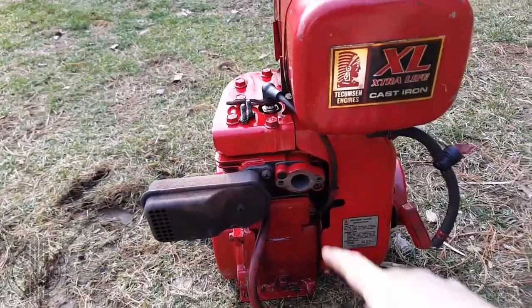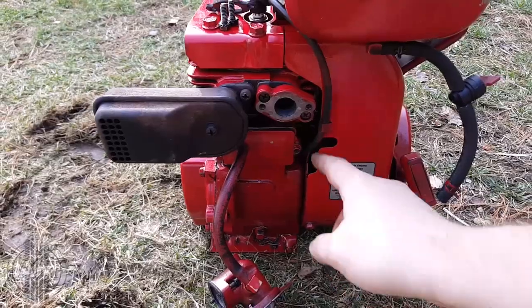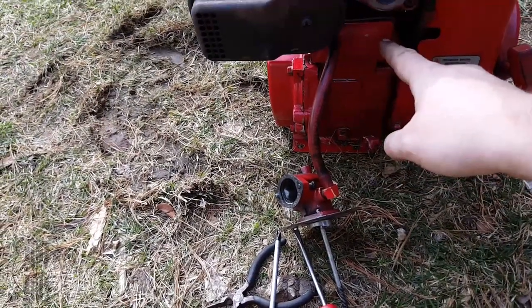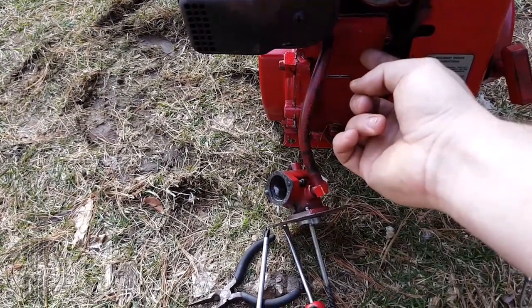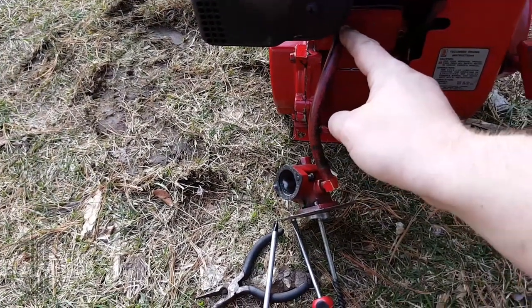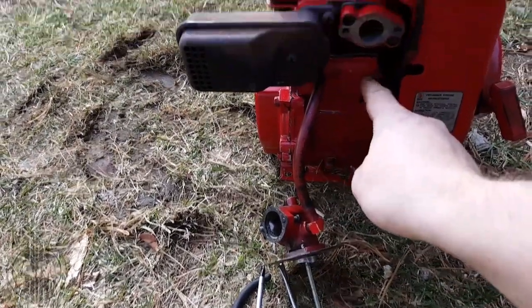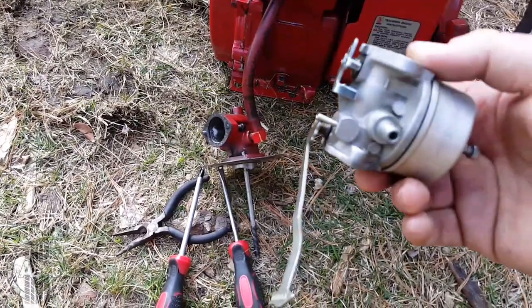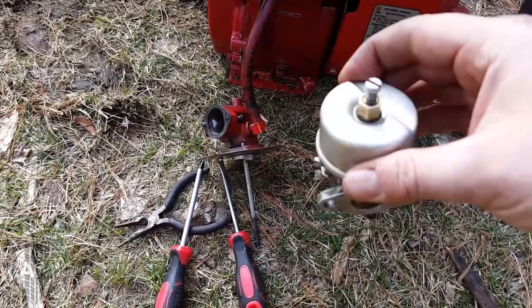We're going to try this again. I just took off the breather box for the valves — I put it in backwards apparently. So I had the cover on the wrong side, which meant it was lower in the pan and right in line with the drain hole. Now it's off to the side and higher. The little mesh inside is flip-flopped. I also cleaned out the carburetor just in case, because I wasn't getting enough adjustment and there was a little bit of gunk in the bottom that I missed.